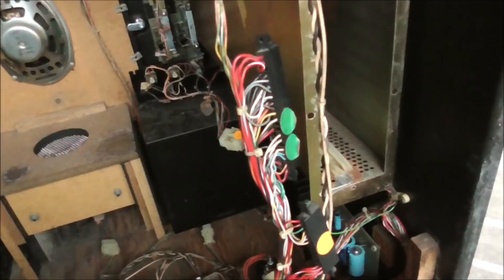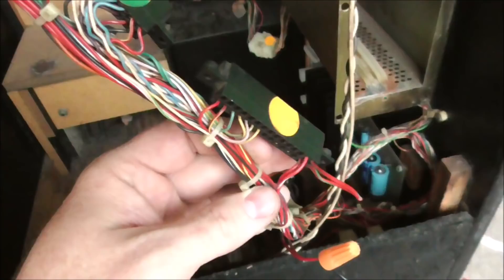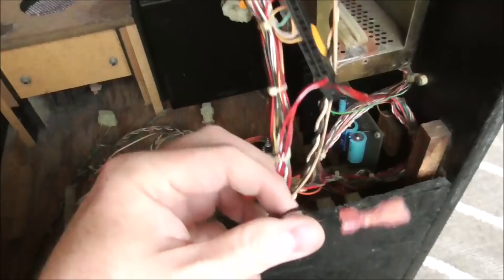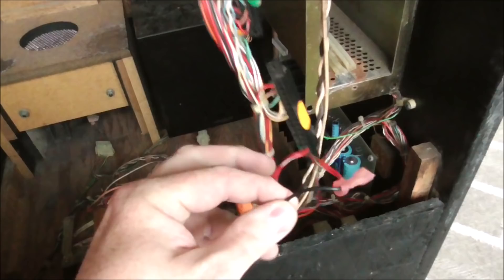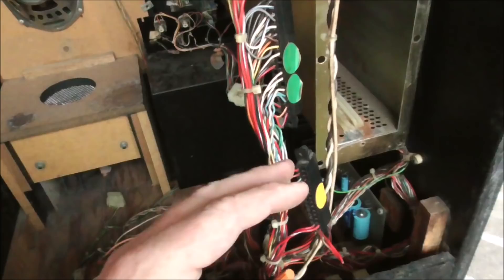The fan setup is because the board runs kind of hot — it's got a whole bunch of custom chips on it and those custom chips cook. You've got to keep it cool. The gentleman we bought this from had already started doing some of the mods — he cut a couple of the wires and put a connector on it so he can attach the power through a spade connector on the edge of the board instead of through the edge connector. We're going to improve on that.